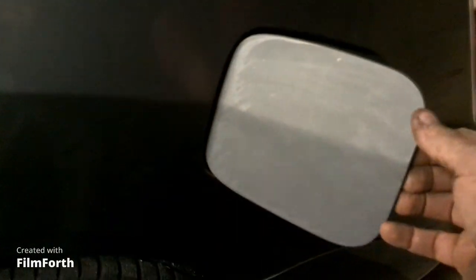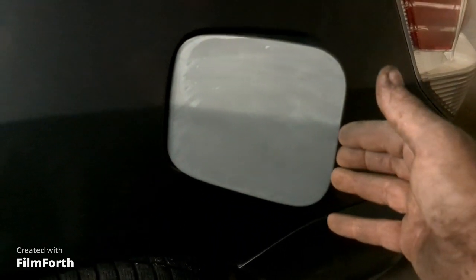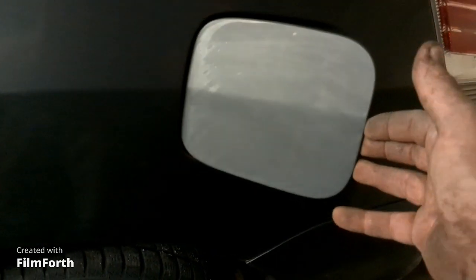It's just kind of gray. Looks like it was based or something and then not cleared. I don't know, it's weird. Anyways, I'm going to rebase it. And then back here, there was that dent right here. So I got inside, I took the panel off the back, and I bumped it out, and I think that's as best I'm going to get it. Put some Bondo in there and block it and make it straight. It'll stay in there a long, long time.